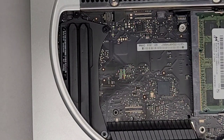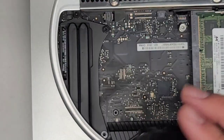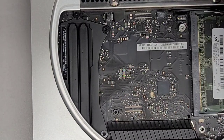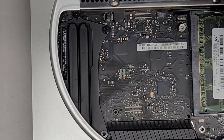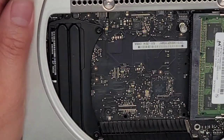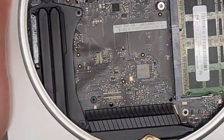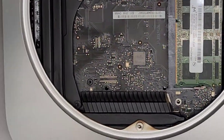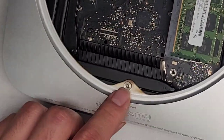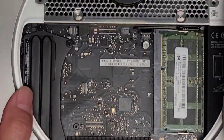I got some of the dust but it's kind of stained that color and doesn't want to come out, so we're just going to leave that. Make sure you keep all the screws and everything in order because if you mix them up, it's going to be difficult to find the exact order to put them back in. I believe this screw stays up here — I don't think that's mounted into anything, so we're going to leave that there.